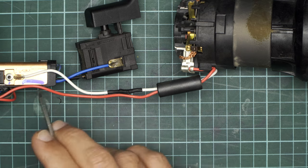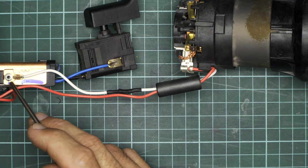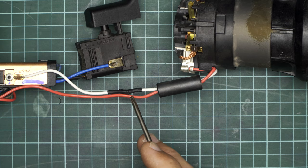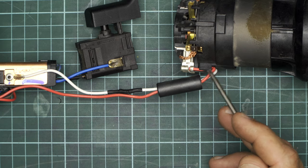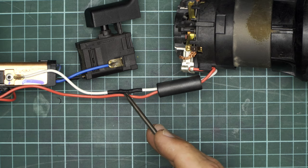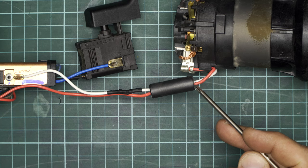Have a look at this piece of white wire here. Now this is one of the wires that goes to the motor, connected to the motor with a flat spade connector, and then onto the MOSFET at the bottom of the device — spot-welded onto a little plate that is riveted down there. But there's a joint in it. I mean, did you actually run out of wire at the factory? You couldn't just make this out of a single piece of wire — the red wire, which is the same length, has a flat spade connector at one end and is spot-welded at the other end as a single piece of wire. Anyway, there is also a ferrite choke here, just to prevent high frequencies and remove a little bit of RF interference.